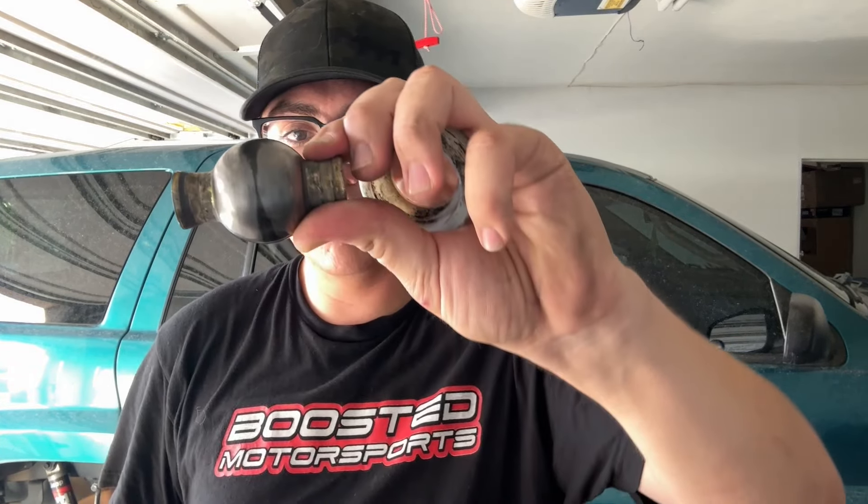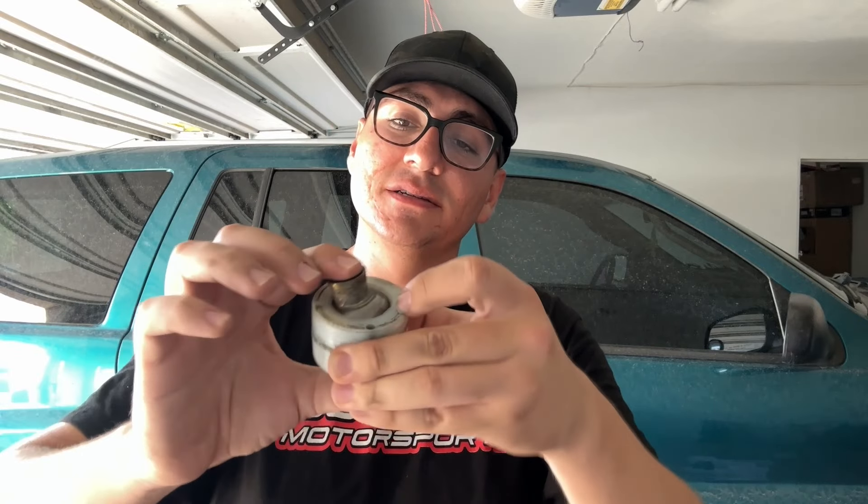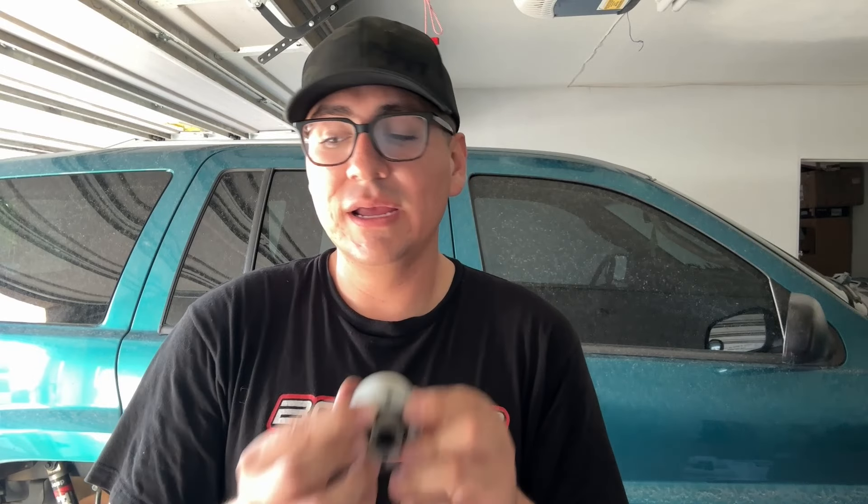These do have four bolts that go into it and you're going to want to re-torque those bolts every so often, because they can get loose with all the vibrations from driving and off-roading. The next thing is you want to grease the joint as well. This is a plastic piece, and there is a metal joint ball which sits in between those plastics and moves around, so you definitely want grease between those two pieces. I've seen people complain online about clunking from these joints, and from taking mine apart I think the issues come from lack of maintenance — people not greasing the joints and not re-torquing them.